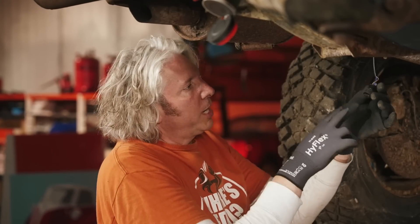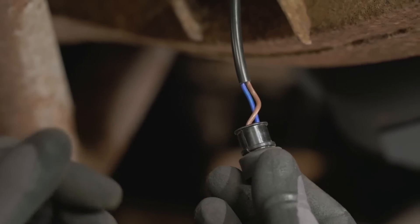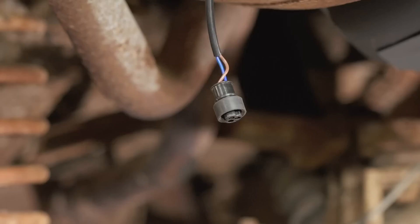What's interesting is when I was playing around with my switch, I actually wired it up as I'd imagined — I figured the brown was probably positive and the blue was probably negative. In fact, the pump then ran backwards. So I strongly suspect that if we swap those wires over, we might have some joy.